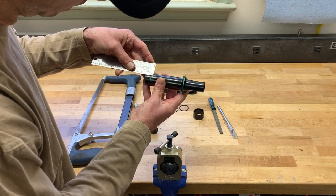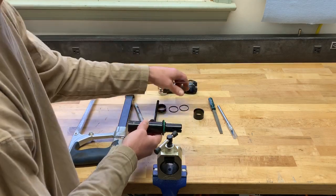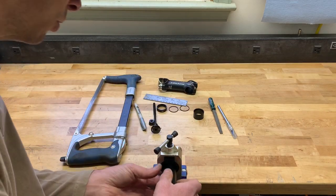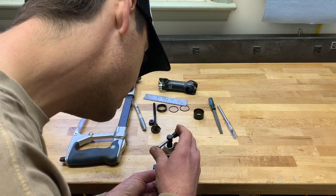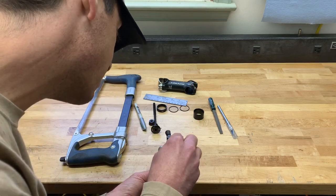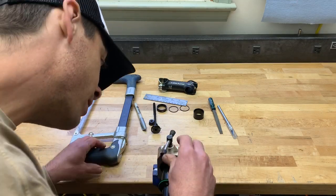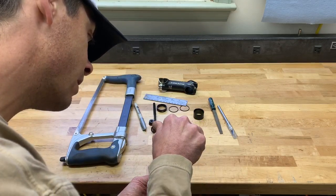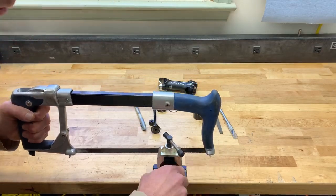Verify that I've got about two millimeters there. I'm going to take the upper portion and clamp it in a steer tube cutting guide, which is a standard cutting guide used for trimming threadless steers — nothing special there. I get my mark aligned and take a nice sharp hacksaw blade.